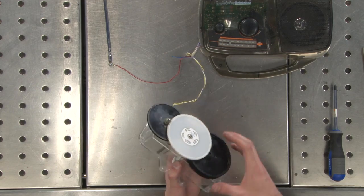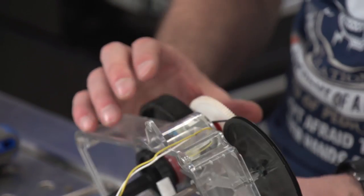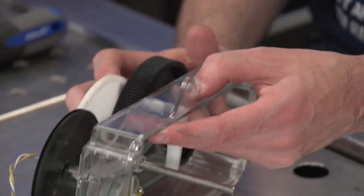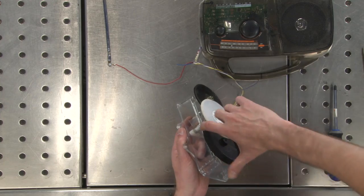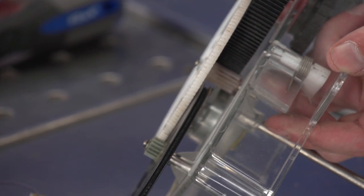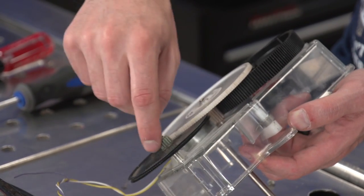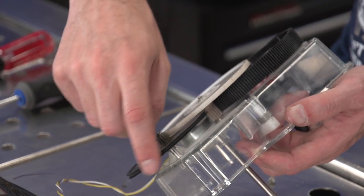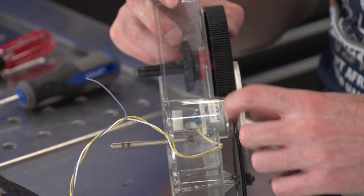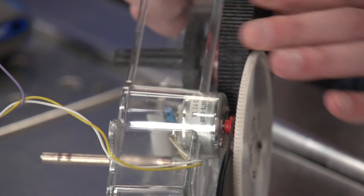And see, all this does is the big spring system would turn this gear, and this big gear turns very slowly. There's a big mechanical advantage. The big gear turns the little gear. This little gear is on the same shaft as this big gear, so this makes it spin a lot faster. You have to push really hard, but it spins way faster. This big gear turns this little gear here, so it's going faster again, and the little gear is hooked to a pulley. This pulley connects this belt to this little electric motor that they're hooking backwards to work as a generator, and it just generates a couple volts. It isn't a lot of power, but it's enough.